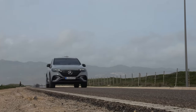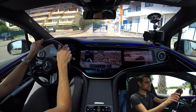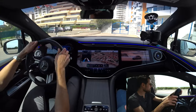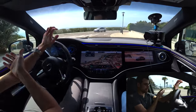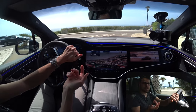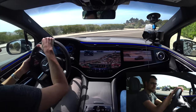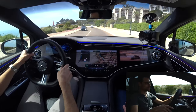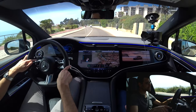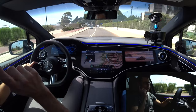Also here in the city, with that shorter wheelbase, the car feels pretty much at home — you can ease it around narrow roads no problem. Most importantly, when you have the optional rear axle steering in its highest setting up to 10 degrees, the rear axle goes in the opposite direction to the front wheels. In situations like these it feels like you're turning on standstill — it's not a small vehicle at all, but this option reduces the turning circle by two meters, essentially giving it the turning circle of a small vehicle.